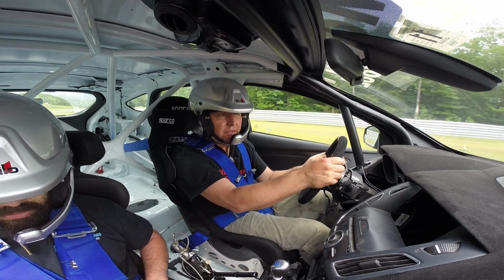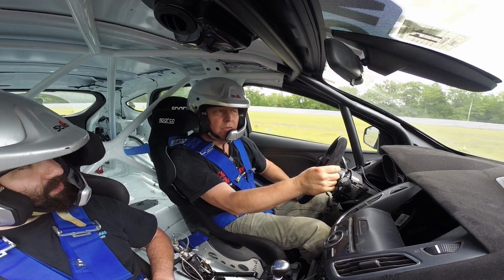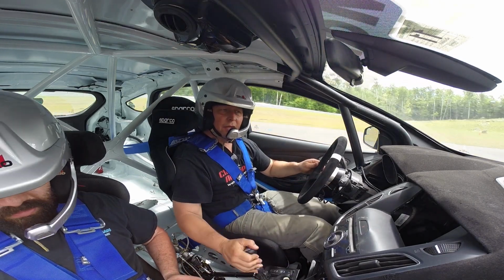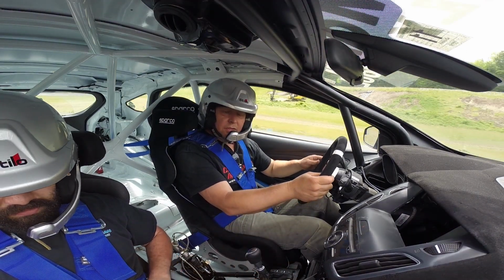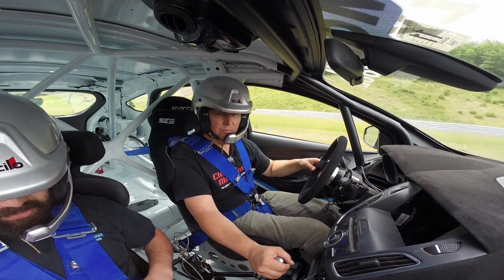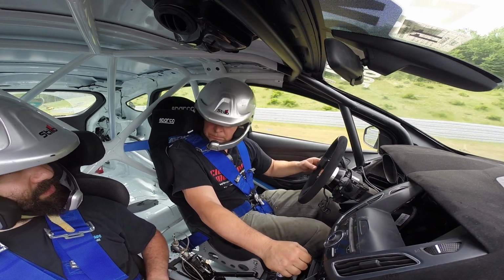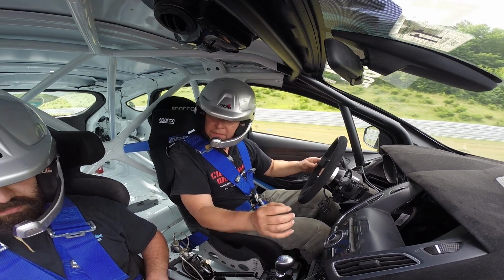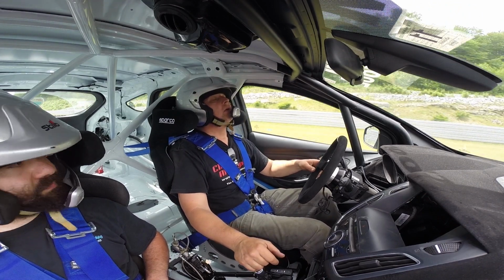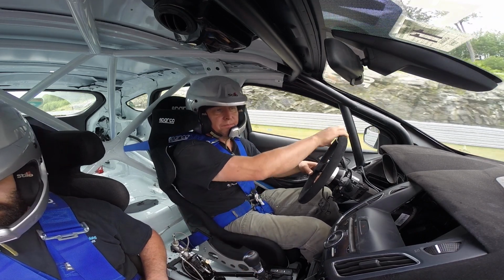Temperatures or anything? The rear diff oil temperature went to negative 268, so it's defaulted somehow, either out of range or something. Did it go up and up and up and then drop right off? Yeah, now it's back to 188. That's the oil, but that's all right. Yeah, that's rear diff oil temp, and that's Fahrenheit. So that's within its limits. It didn't flip out.